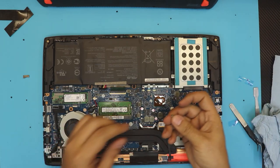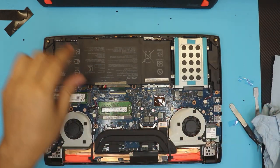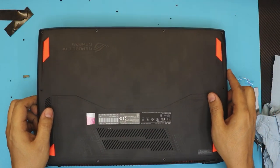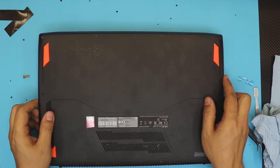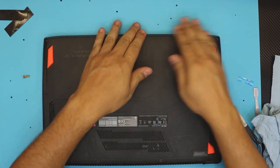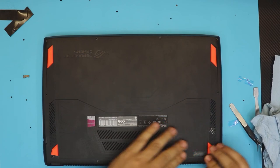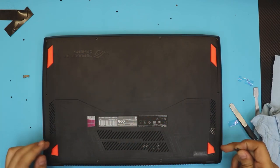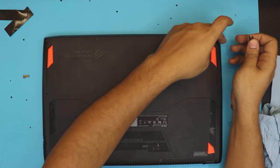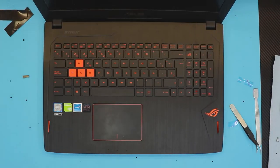There's still one more screw here that goes right by the fan. Grab the bottom cover, put the fan side down, and push down the sides — not the middle first, then the back. Put in the large red-marked screws from the mid area towards the back, and the blue-painted shorter screws in the front row. Thanks for watching guys, and I'll see you in the next video.